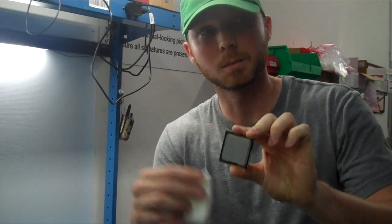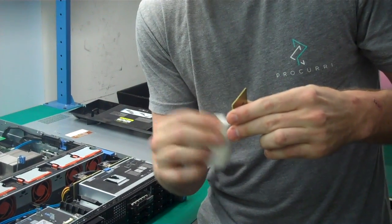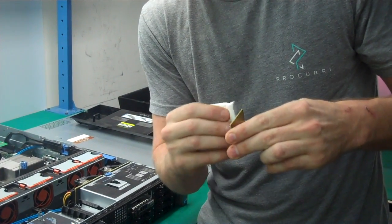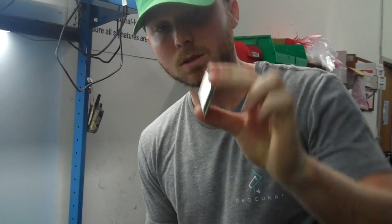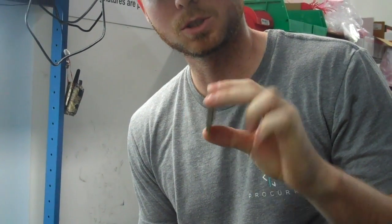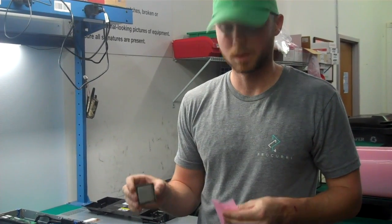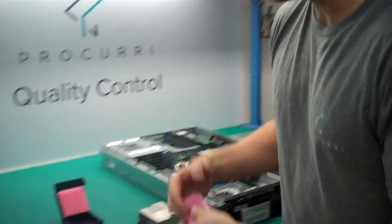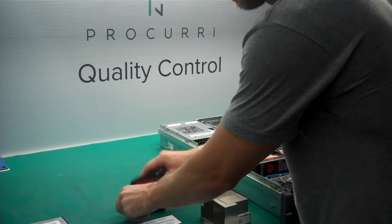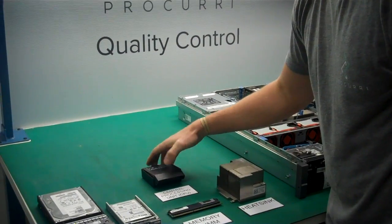As you can see, it has some thermal paste on it. What we're going to do is take just a little bit of cloth and go ahead and wipe it nice and clean, because the information about the processor itself is on the top. As you can see, we have an SLB-WZ, which is a 2.4 gigahertz. Because these are very valuable, we want to make sure they stay safe — we're going to put it in an anti-static bag, wrap it up, and to make sure it doesn't get damaged, we're going to put it inside the processor box, which is also anti-static and good for storage.